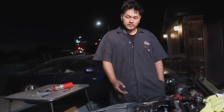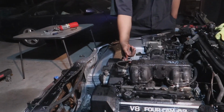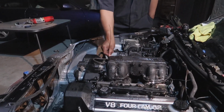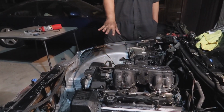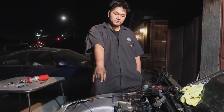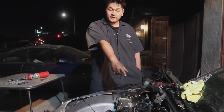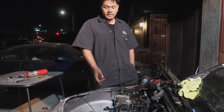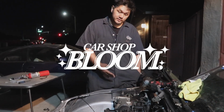So we're gonna go ahead and get a new one of these. This is a little bit too big. I don't know if it needs to open a diaphragm for this to return, and there's just too much fuel in here or something. We're gonna get a new vacuum hose for the return, fix that wire, make sure there are no more fuel leaks, and then try to start it again, and hopefully it starts. Okay.